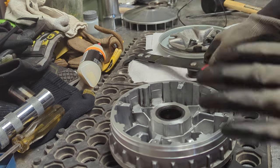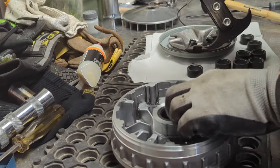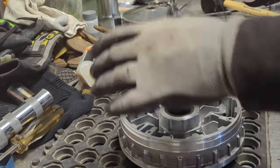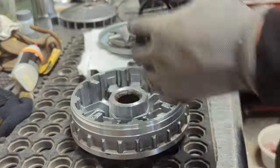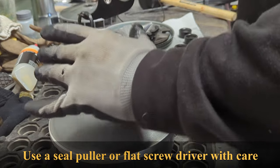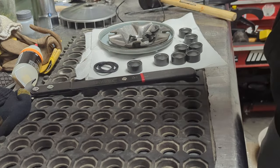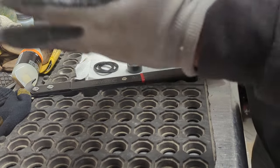There's a grease seal on both the inside and outside of this outer primary. I've got this seal puller — it looks like a trailer wheel bearing puller — and it pops the seals right out, no problem. That's going to allow us to clean the inside where the shaft goes through. It is really nasty and crusty in there, so we need to clean that out to inspect it.